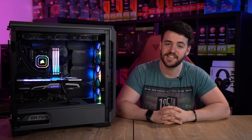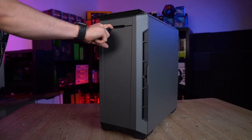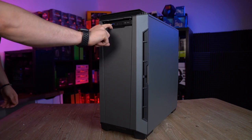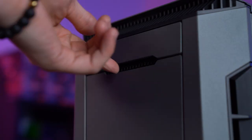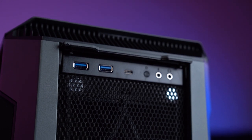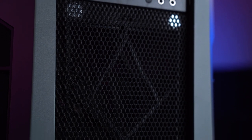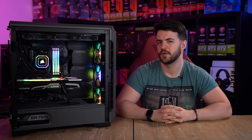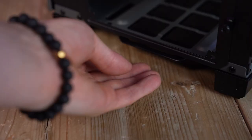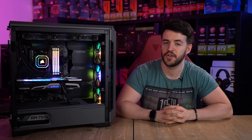What is most impressive about the P600S is its modularity and ability to transform from one configuration to another. The main feature is its interchangeable modes from acoustic bliss to high performance airflow. The stock configuration is in silent mode, and to change this, all you need to do is remove the magnetic center panel at the front. If you have small fingers, this comes off without any fuss, but I had to flip up the IO cover. Once removed, the next major feature in Phanteks' repertoire is revealed — their fabric mesh. The mesh is highly breathable nylon and allows for even more airflow compared to traditional mesh filters. There appears to be a double layer of nylon mesh further supported by a magnetic dust filter at the back, which works in tandem to restrict the amount of dirt going into the system.